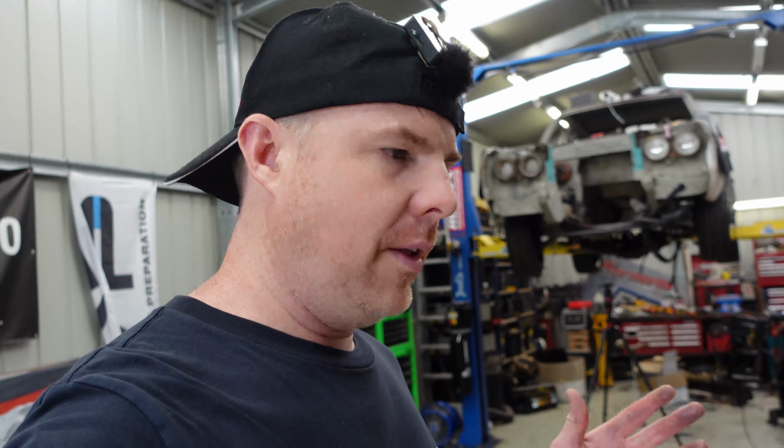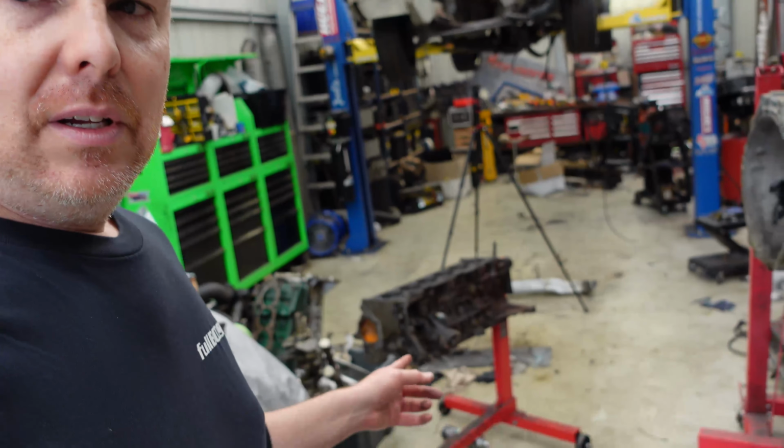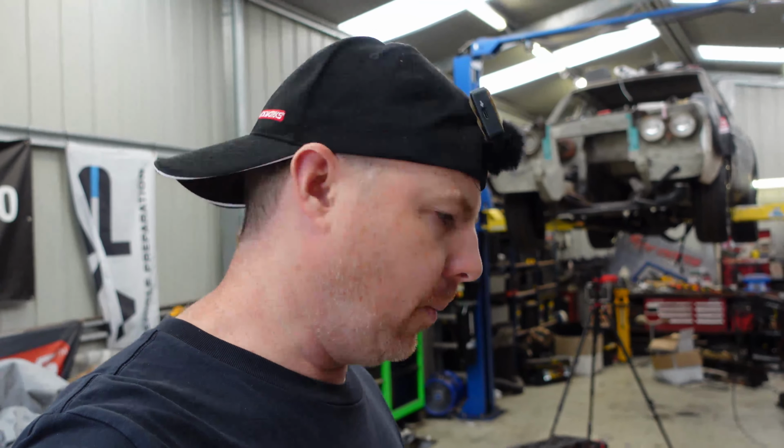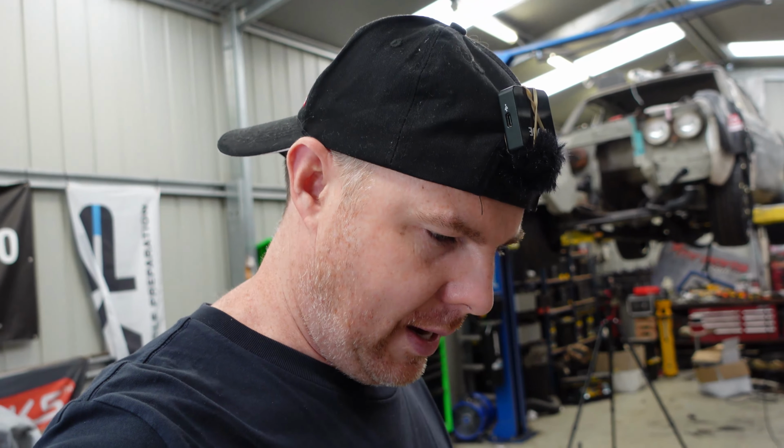However, the things that a lot of people don't do, of what I've just run over, is that your bearings can be absolutely shot depending on the kilometers the engine's done and how well it's been serviced in its life. And if your block has absolutely no cross hatching left in the bores, it is just going to blow oil out everywhere, and it's not going to seal great either. Now, the second thing that is key to sealing in terms of making power is the cylinder head. So let's have a bit of a look here at what we've got in store for the head.